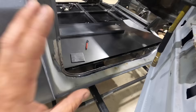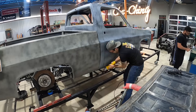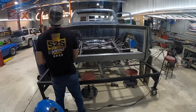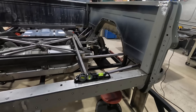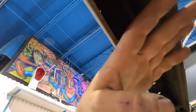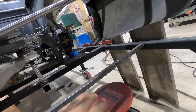Our bed and cab is hung, everything's pretty much where it needs to be. These little makeshift braces we made to hold everything up, we're going to cut those out of the way and get those free. It's awesome to see the cab and bed finally sitting under their own weight. We have this angle piece that was here supporting the bedsides cut away, cleaned up the rear frame rail. Now we have to box in the underside of this frame rail - it's completely hollow - so we're going to take some 16 gauge and sheet metal this all in here, and add a little flange right here.